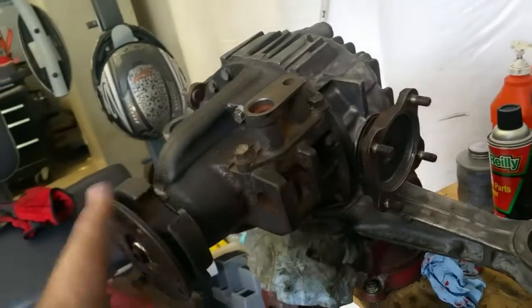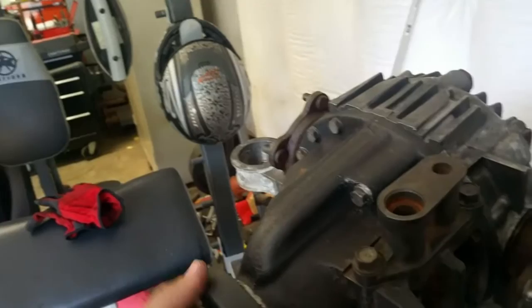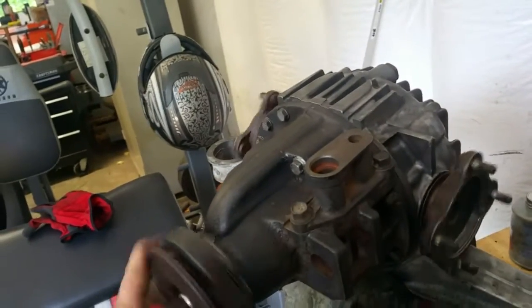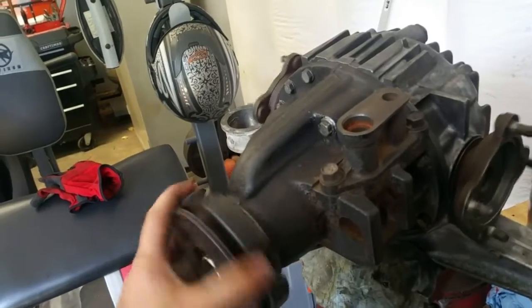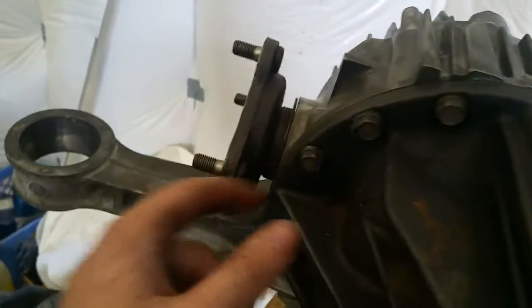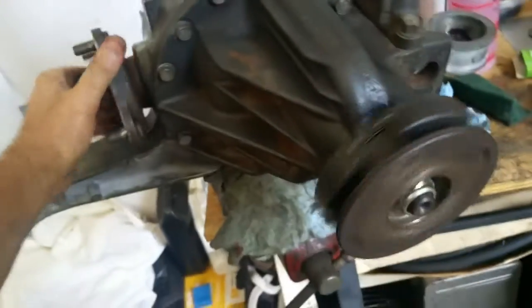Here's the diff put together and complete. I set the housing down on the ground and lowered the diff chunk into it, applied RTV all around the inside mating surface, and have since cleaned off the excess. Some RTV probably got inside the diff, so if you do this make sure you wait about 24 hours before running it. That's it.